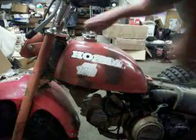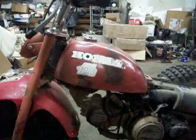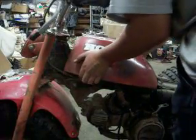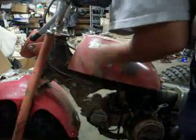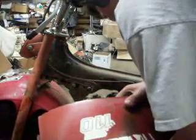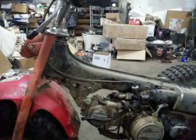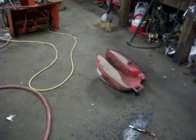What we're going to do is turn the little knob on top of the gas tank lid — it says on and off, there's a little knob on most of them. Turn to the off position so fuel doesn't leak. Then get the fuel tank and slide it back off these two little knobs. Set your fuel tank upside down and it shouldn't leak.